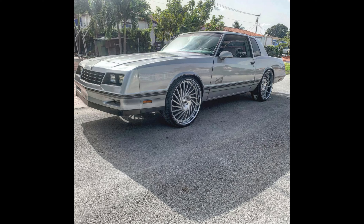Back to the wheels — I like the race look and I like big wheels on G-bodies. I'm from Miami, I was basically raised that way. When I say big wheels, I like to go with the biggest wheels you can fit without cutting or trimming anything on the car. So I went with 24-inch 4G Auto wheels — 24x9.5 on the rear and 24x8.5 on the front. They are three-piece wheels, making them really light. I did not have to do any modification whatsoever other than rolling the fenders. The wheels fit perfect; I dropped the car in the front and back for an even and perfect stance.